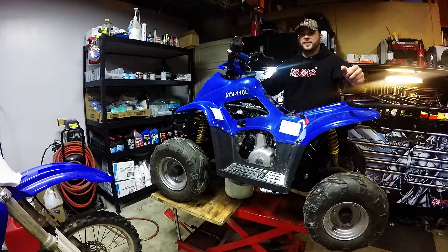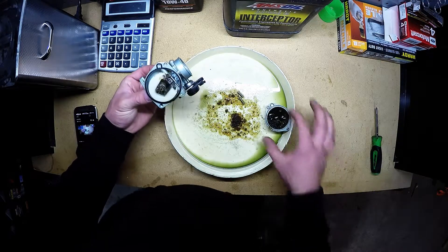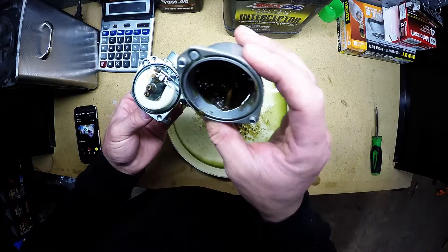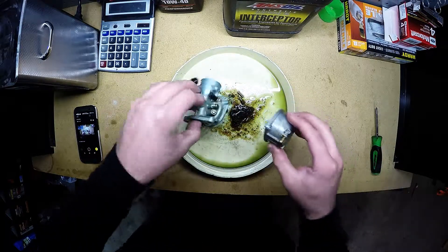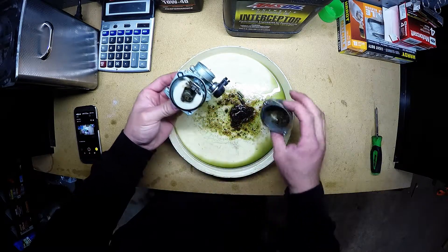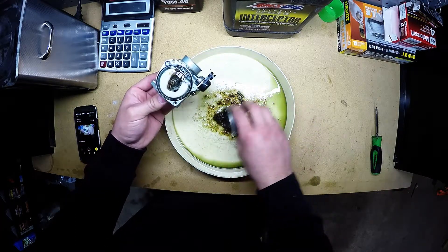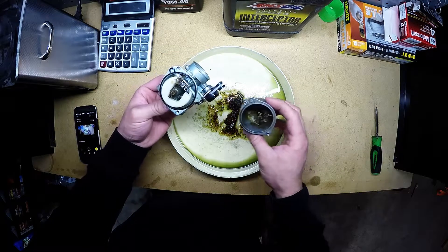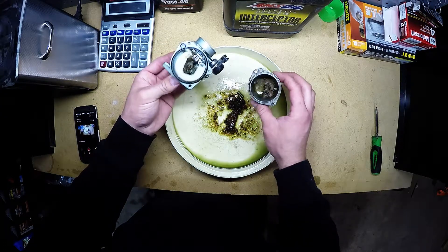This is one of the worst ones I've ever seen. So I have the carburetor part over here on the bench — I'll just take a look at it. I just cracked this carburetor open off this little tiny four-wheeler and this is what was inside. That is like the grossest thing I've seen in a carburetor so far. People say ethanol fuel has an effect on these fuel systems — well here's the proof right here. It's god awful, it's like horrible jelly. I don't think this was sitting all that long; I bought it off a guy and he said it sat about a year or so.